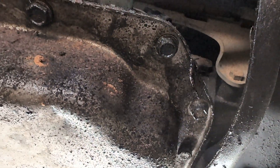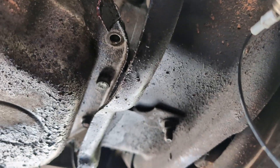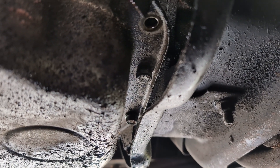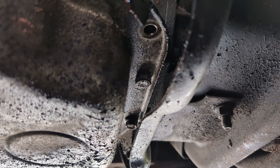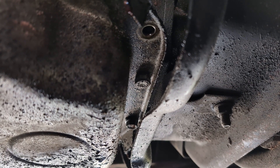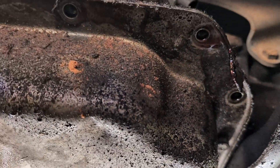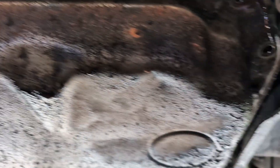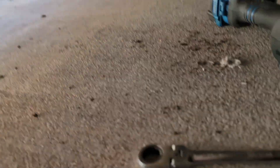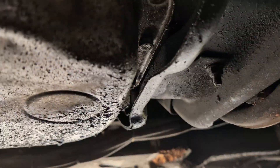Eyeballing it, I'm going to say that's a 9/16th. Let me go get the appropriate tooling. One thing to note — you see that bolt right there in the middle in the back? It doesn't appear to have a washer on it. That's a 9/16th, but all the guys around it are actually 1/2 inch. Don't know if that was somebody doing a repair, but just be aware. I've got a power tool and I'm working my way around. There's one in a tight spot, so I'm going to use a flexi 9/16ths and hopefully that'll get the job done.